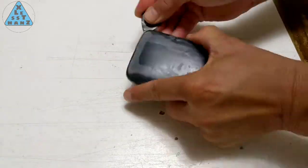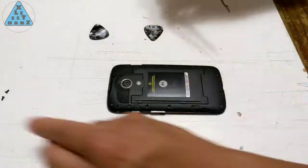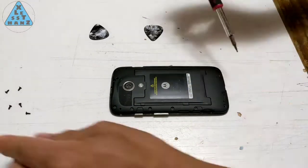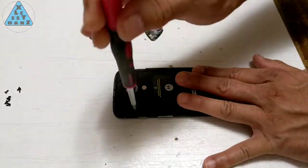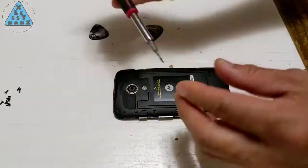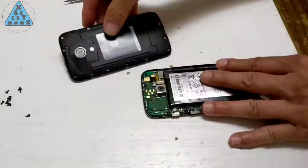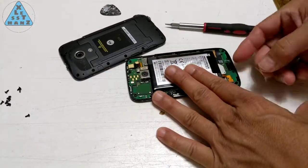I'm going to do one test today. I'm going to test the PCB, flex cables, components, and screen. The battery will be removed for this test. I'm going to submerge a working smartphone in lacquer thinner for 12 hours, after which I'll let it dry for 12 hours. I'm then going to reinstall the battery and power up the phone to see if it still works with some minimal feature testing.